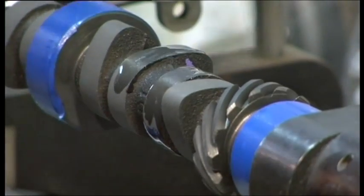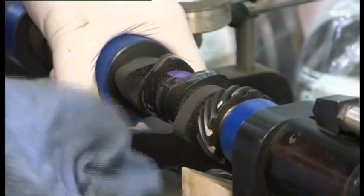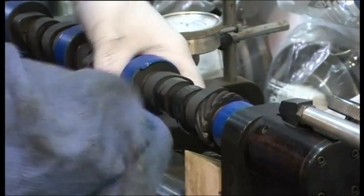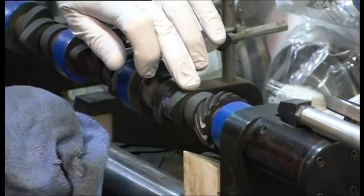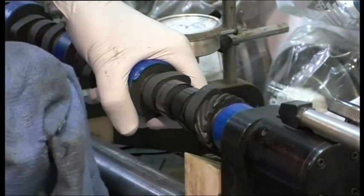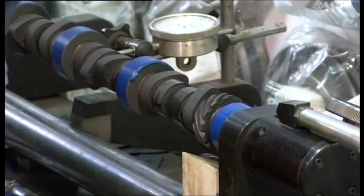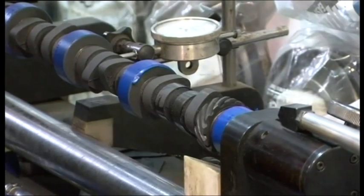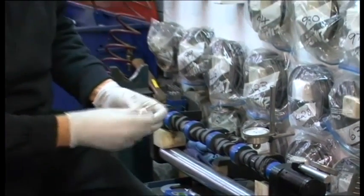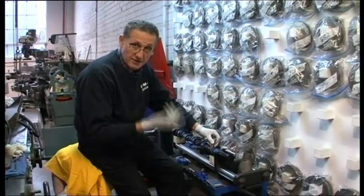As we did with the last cam — which was just a fully ground surface — if you look carefully, you can try to wipe it off, but it really doesn't go away. It just stays there. It remains greasy and you can see it remains shiny and dark, because the oil won't wipe off. The Lubrite is like a furry surface finish, and most of you who've installed a cam have felt that. It holds oil so that when you first start your engine, the interface is always wet, always has lubrication.